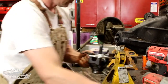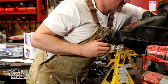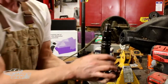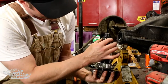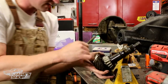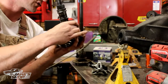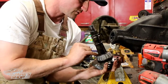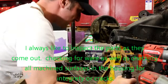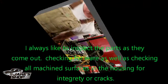Yoke's off. And this time the pinion slid right back too. Sometimes they can get wedged in there and you need to beat on them. You can see what the pinion's about now. We've got the crush sleeve here from the old pinion. You've got your bearings all pressed into place and your shim pack is underneath here. This is the bearing that's real tricky when we go to put it back together. Now she's pretty much apart. Next few things to do here are remove these seals and that race.